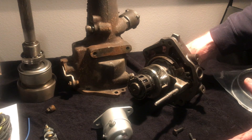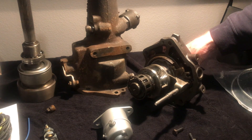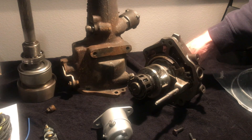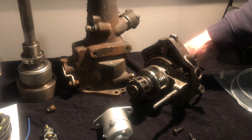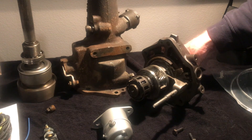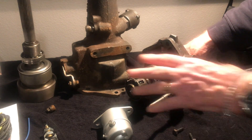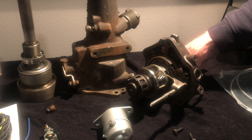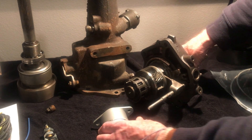They had a little bit different wiring schematics — wired them up a little differently, and the color coding was all a little different. So if you look at a Studebaker versus a Ford, the wiring colors are not compatible, but they're all essentially the same components and are interchangeable. You just have to understand how to wire them up. Vintage Auto Garage has come up with a wiring harness and a really good set of schematics to help with that.